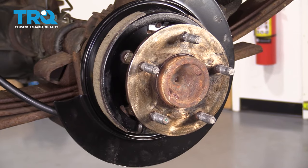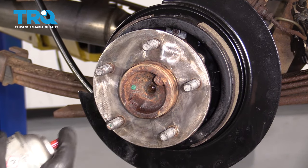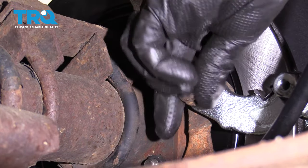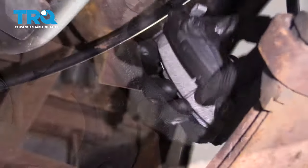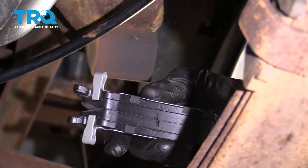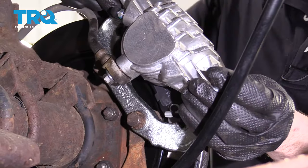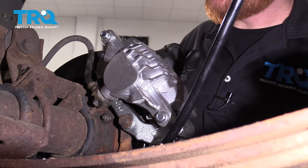Let's look at those U-joints — if you see a grease fitting, make sure you put some grease in it. Now the next thing we're gonna wanna do is go ahead and clean down our mating surface of our axle so that way when we put on the rotor, it'll sit flush. Use a little bit of copper never-seize along this area. Let's continue by putting on our caliper bracket with our caliper bracket bolts — I always like to use a little bit of red thread locker on these. Snug them up and then torque them to 52 foot-pounds. Now it's gonna be time to put on our brake pads — line up the wear indicators so they're both facing on the same side. Put the top area in, line up the bottom, and put that in as well. Now let's take our caliper and slide it right over those pads. Push in on the sliders, slide the caliper over it, and put on our slider bolts with a little bit of red thread locker. Snug them up and torque them to 23 foot-pounds.